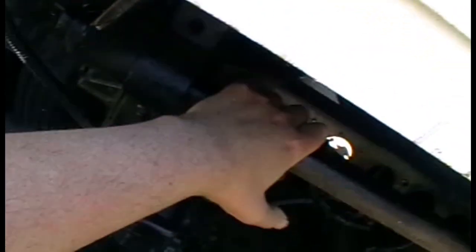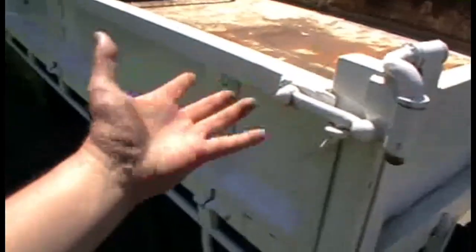So this bar, which is just a big hinge pin, will be able to be lifted up. And I'll build hydraulic rams on each corner, which a lot of hi-abs have. I'll make it so that a piece of metal slides out here and it will go down with a hydraulic ram. So it'll lift the whole truck up, which will lift the motorhome off my truck,